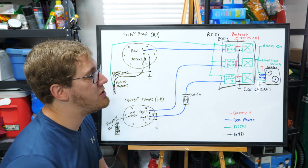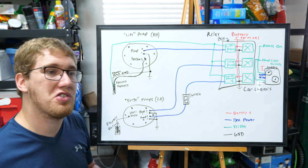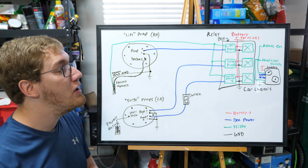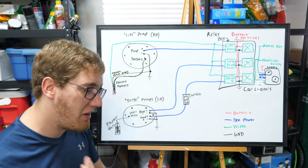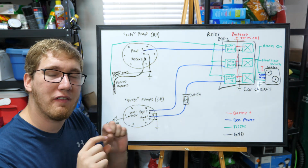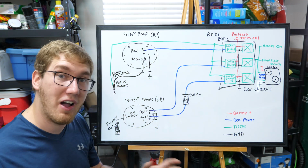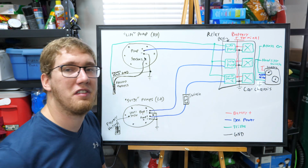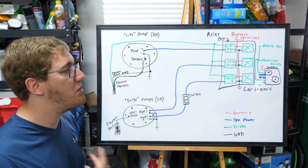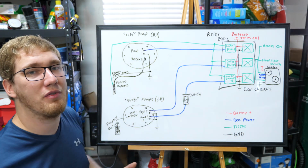However, as we're beginning to tune this car and after we've installed the supercharger, it's going to be nice to be able to see that reading while I'm actually inside the cabin. So I've decided to install a digital pressure gauge, which uses that access port on that fuel fitting, which is connected to the factory line that I showed you earlier. That just plugs in there and then connects back to that gauge, which I can monitor inside the car so we can make sure that we're getting a 1-to-1 increase with fuel pressure.